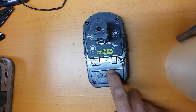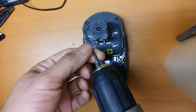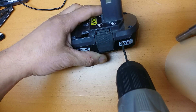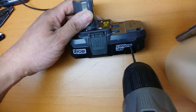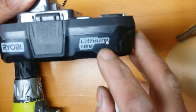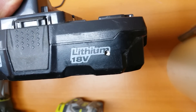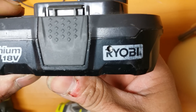All I did was I took my RYOBI drill with a 1/8-inch drill bit and drilled according to the internet picture. I drilled a hole here right on the R on the RYOBI label, and did another side over here on the M. The holes are right there — see the little metal piece? There's the other metal piece — those are the terminals from the inside where the positive and negative connect.